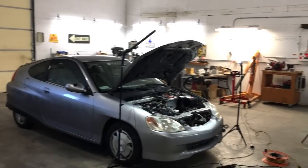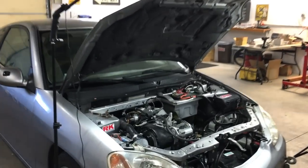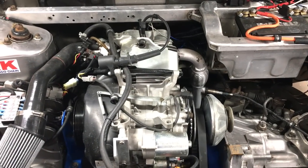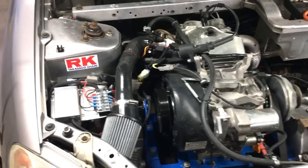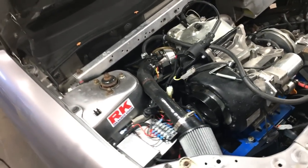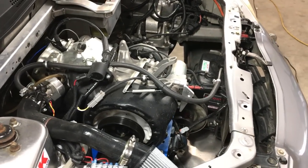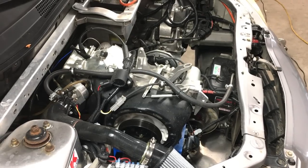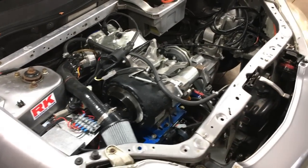Let's take a look at what we're going to be testing today. Most of you folks will recognize the 420cc street-legal go-kart. Right now the car is set up exactly the way it was back in episode 28, except the transmission seems to be working pretty good. It has the Speeduino NO2C EFI with more or less a working tune, so we're going to establish a new baseline — unfortunately the supercharger has been removed temporarily. The engine starts and runs just fine, and we did a sprocket swap just before the season ended.